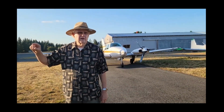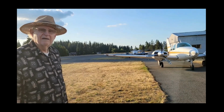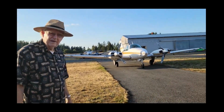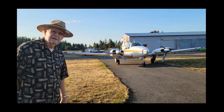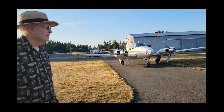Well, I don't think I ever put the gizmos on the wing, you know, the little... vortex generators? Yeah, we did put them on. No, that's okay. They were on there. Remember we were doing that slow flight before we realized about the flat spin characteristics? Yeah. We were doing power on stalls. Yeah, that really made a difference. It reduced the stall speed by about 6 or 8 knots. And it was really docile too. I remember how smooth it was when you'd stall it. Yeah, the vortex generators are a must-have.